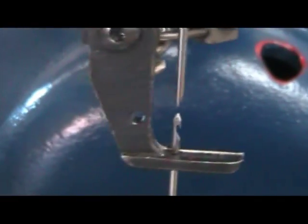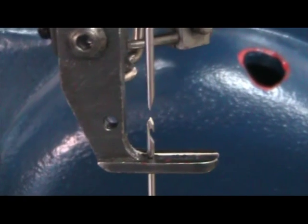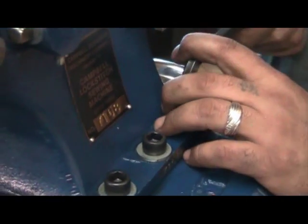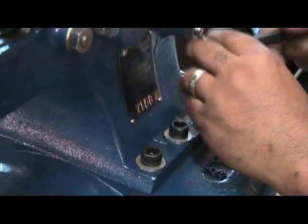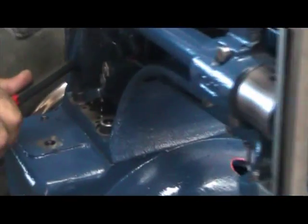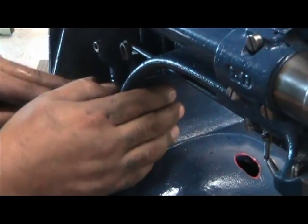Now we have our alignment of needle and awl directly on top of each other. We spun that awl around until we got crosshairs, pointing the needle right in the center of the awl. When you find that position, hold it, and start to firm up your screws. Be careful not to hit those screws hard because you can move the head again. Little by little, start locking it down, then tighten it even more once it's firm. After you get your head bolts all tightened down, put your crank back in position, reconnect your linkages, and you are ready to go.